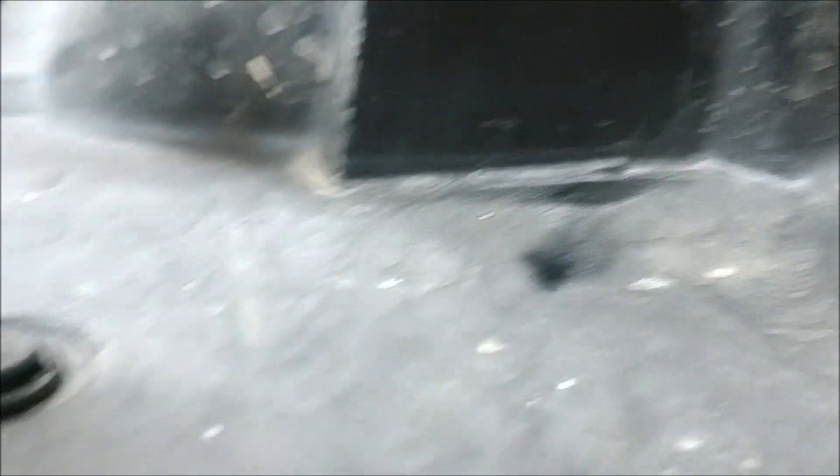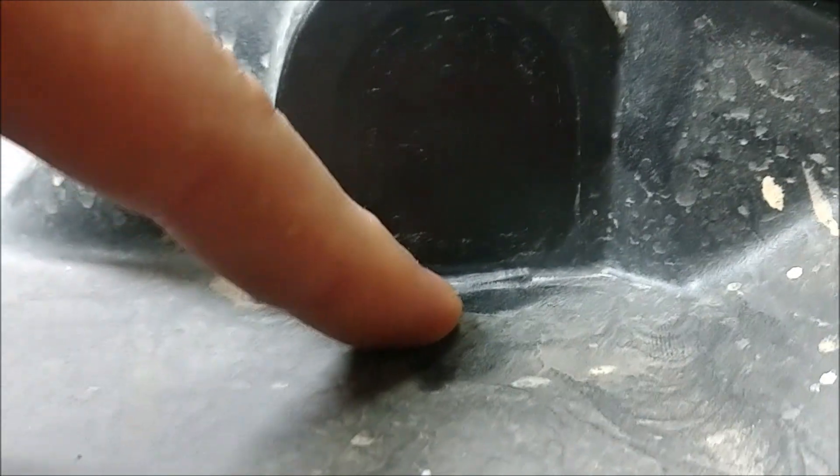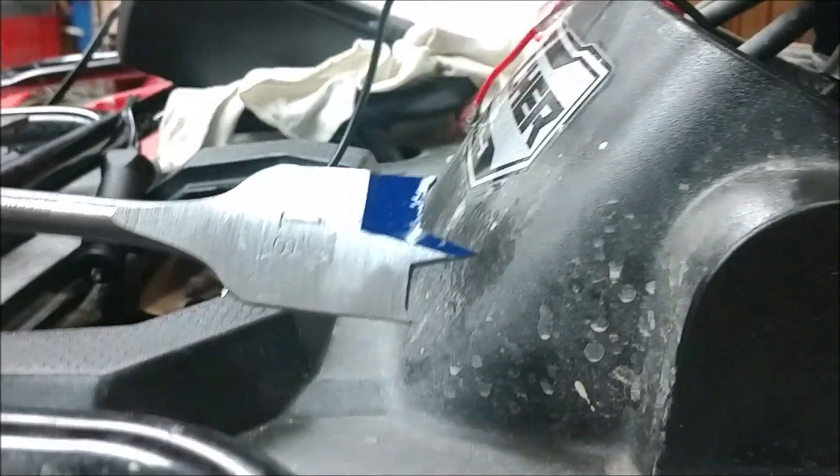I can measure and mark this, but if you look really close on here you can see the little spot where the plug is supposed to go from factory. I'm going to find about the middle of that and put it a little higher, so that if water splashes up it won't get up into that plug. So I'll set it a little higher and drill the hole.